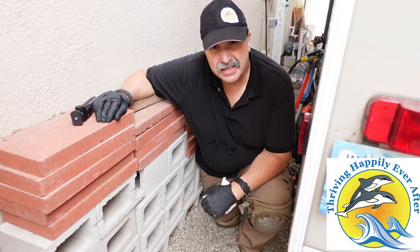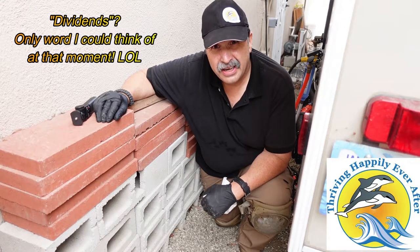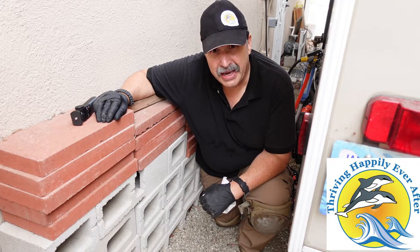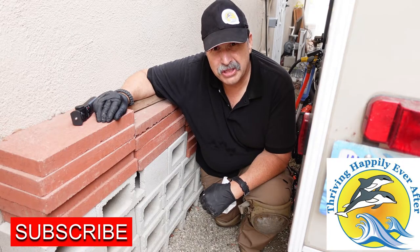Part of the reason you want to fill these things up a little bit is the more water pressure you have, the more it's going to start flushing that stuff out. And that's really going to pay out in dividends when it comes to the odors emitting from your tank, especially if it's stored in a hot environment — you're going to smell you have a problem right off the bat because the black tank is simply not flushed out correctly. I can do this at home, but at the very least you can be doing this at a park or wherever you dump your tanks. You definitely want to go through a few cycles.